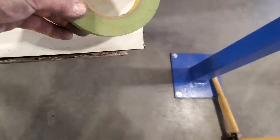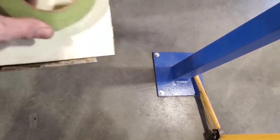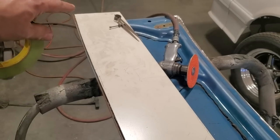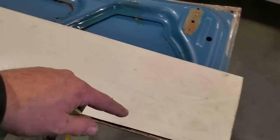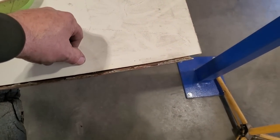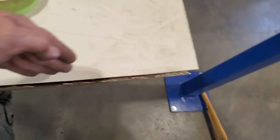All I'm going to do is use 3/4 tape, because this is the height, and that's a lot more than the actual height on the end of it when you bend it up. So I'm going to take 3/4 tape now and strip it out right along the edge of it there, just so then I got a nice edge that I can mark, scribe along there, and I'm going to bend it. I'm going to bend this lip then, bend it up at about a 45 degree angle along here, and that way the shape will stay the same and I'll have a lip on it.